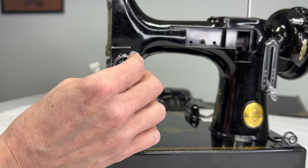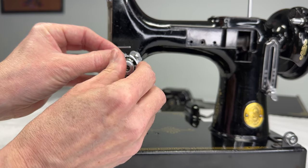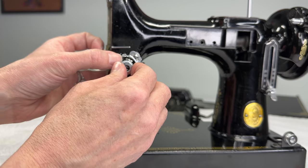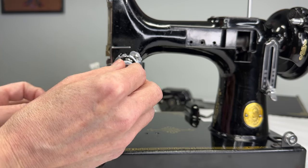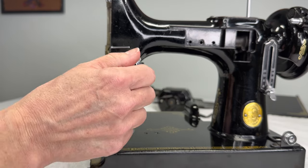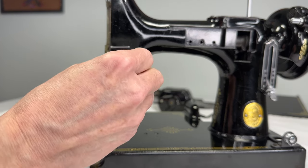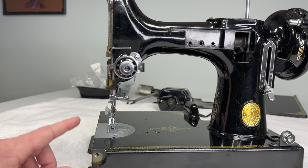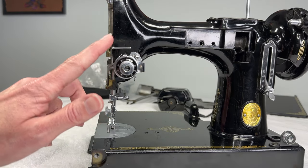Put the flange back on with the two towards the ceiling, oil the parts a little, then with chrome side out start the thumb nut on, pushing back the spring as you go. You don't need to screw it all the way — just enough that when you turn it to zero it doesn't fall off and grabs at least some of the threads. You should be able to turn it clockwise all the way up to nine or counterclockwise to zero, and it stops but doesn't come off.